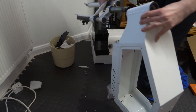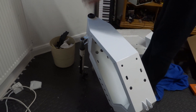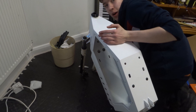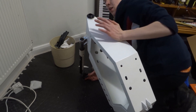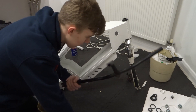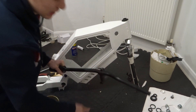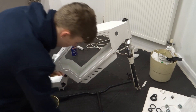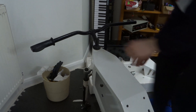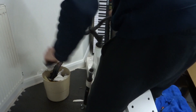Okay so now we have both bearings installed. The fork fits on like that. Now obviously the top looks a bit weird — this is not an ideal fork. Ideally you'd have like a double crown proper off-roading fork, but I don't have one at the moment. That is definitely an upgrade for the future, but for now this is going to be absolutely fun. Okay so here are the handlebars. Anyone who knows a lot about bikes will know that these aren't the best handlebar style — they kind of go inside and then clamp. But again this is all I've got, it's going to work with this fork, so fingers crossed it should be okay. Now what I need to do is make sure that these two are in line — and there we go.